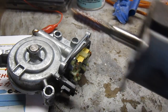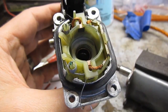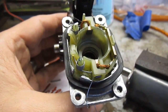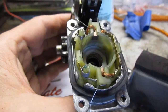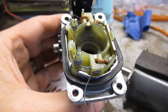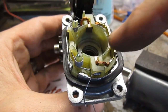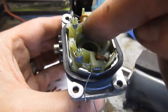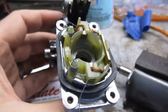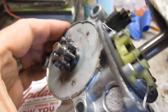The clocking position is the rubber pad — it faces the door panel. I've got the hooks in there for attempt number two. I put a little bit more of an angle on the end to get them to hold down. This back one is hard because this connection is in the way, so whatever you need to do to get them to pull back, just do that. But make sure you don't bind that spring too much because we're going to have to pull them back out. I got the brushes pushed all the way back by grabbing this wire up here, and that seems to hold it.